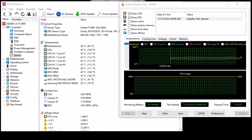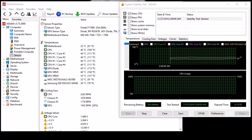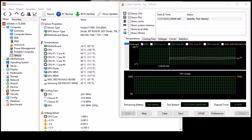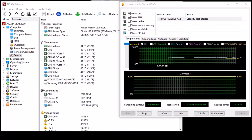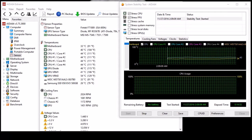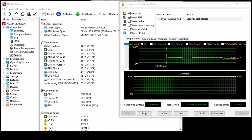With the water cooler installed, the temps aren't nearly as impressive as they should be. It is cooler than the D92 — it peaks at about 41°C and hovers around 40°C — although the fans are quite a bit louder. Part of that is from vibration; I think I just need to find some rubber washers to dampen the noise. It's going on almost 15 minutes now and staying stable.